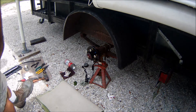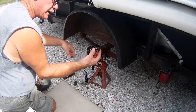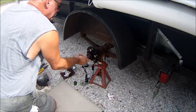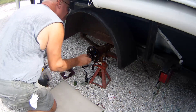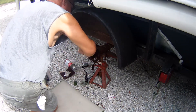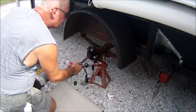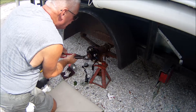I'm back. I've got the washer this time. The only parts you don't get are the washer and the castle nut. You just put the washer on like so. Put your castle nut on. Spin this a few times - that's a good idea. That's much nicer than the old one, I'm sure. Now that's one turn and the hole's lining up and it's too tight, so back it off a turn.